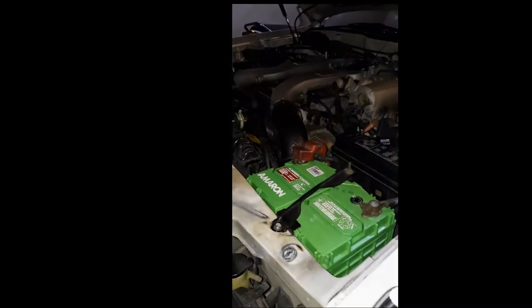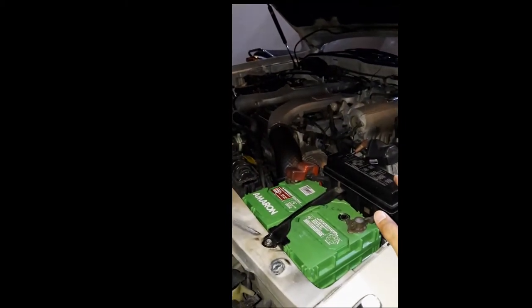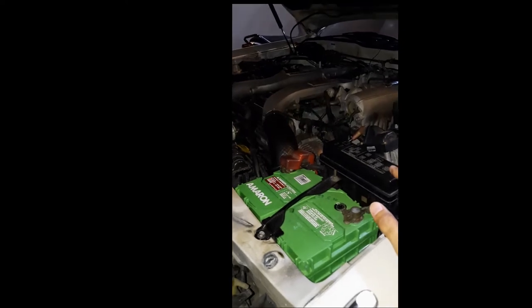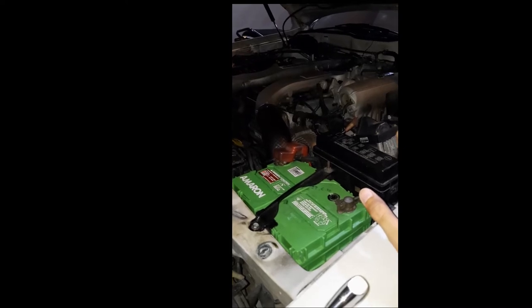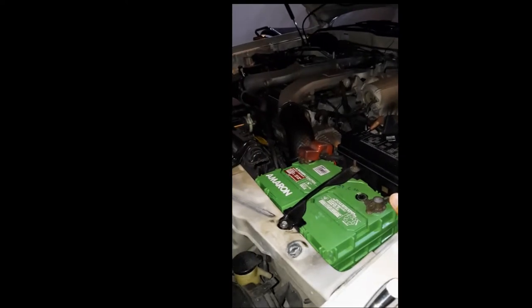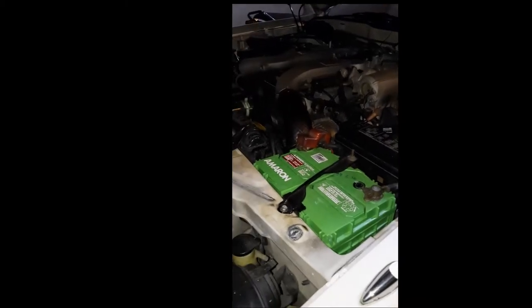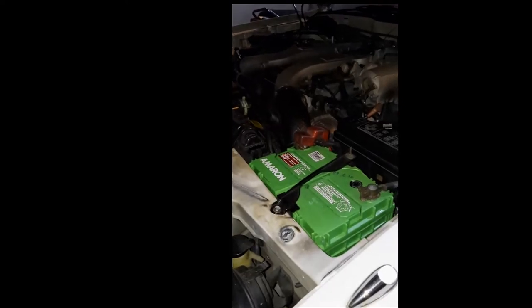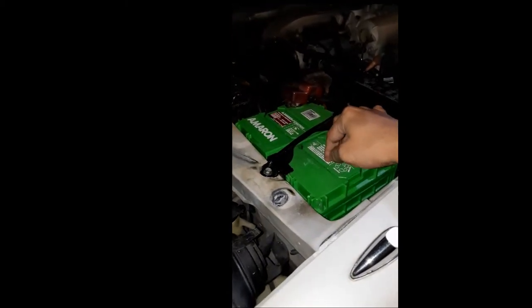So in order to reduce heat soak, one way is to lift up the hood like this. If you lift up the hood, it actually cools down a lot quicker. You can lose turbo temperatures like 20 degrees Celsius within 15 minutes. But the problem is you need to lift this hood up every time after you drive, so this is not ideal. You can't do this every time. So one thing that I've thought of is trying to switch on some kind of fan with a temperature sensor. But first we talk about what is affected by heat soak.